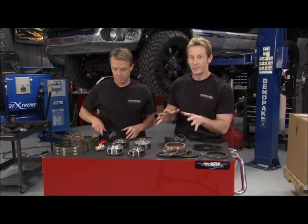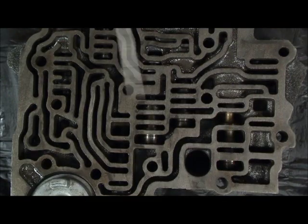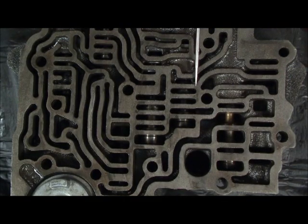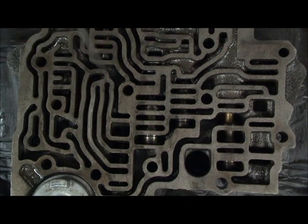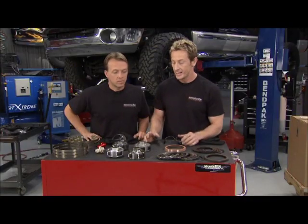The smell is undeniable — you can't get rid of it. Matt talks about the contamination: we've showed you guys a valve body before, and there are so many oil passages with pistons going back and forth, engaging a gear and disengaging. Any little contamination can plug that up, and that's how you can lose a gear, lose reverse. It's a vicious cycle of contamination, which is not good.